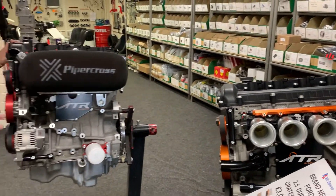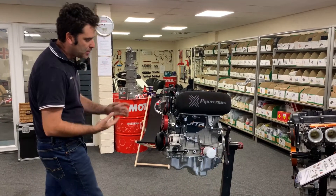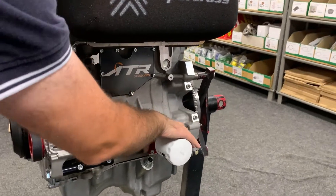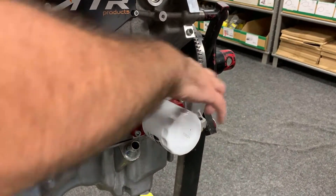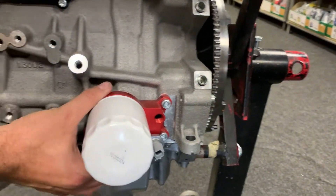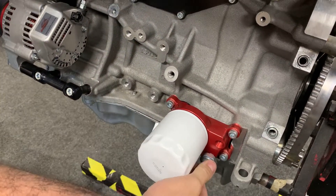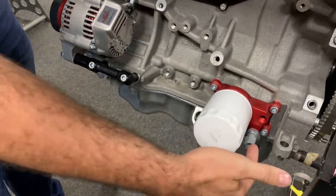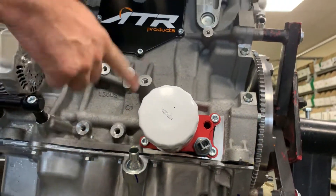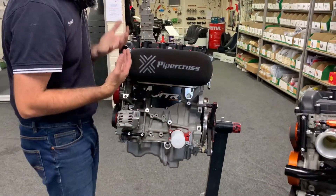This particular one here with all the red anodised parts will be going into an Escort Mk1. Some of the parts on it — we've got the oil filter housing. The standard Ford oil filter housing is quite a big unit that comes down and it's also got a heat exchanger built in, doesn't suit most applications, looks pretty untidy. So we've got a really nice billet one. It takes a standard screw-on filter, and then we've got the pressure sensor for the warning light and a second one where you can put your oil gauge in. It is possible within the housing to drill and tap and put a third one in if you need to for certain motorsport applications.